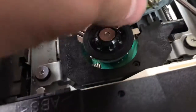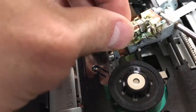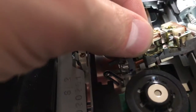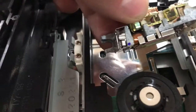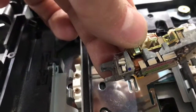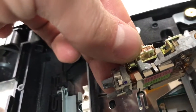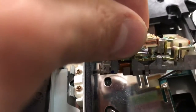Instead of taking it all apart — which you don't need to do — just lift it up a little. Get a q-tip with some alcohol on it and rub it on that little plate right there. It looks like a magnifying glass. I would clean both sides — under the little laser under there, and you can see the little window up top right there on the tip of my thumb.